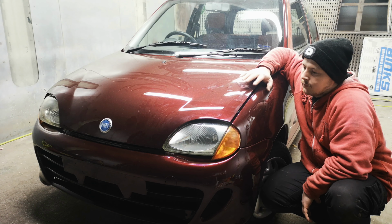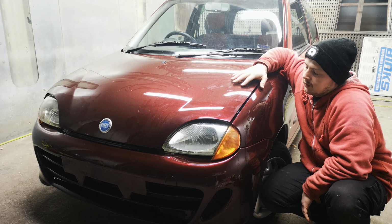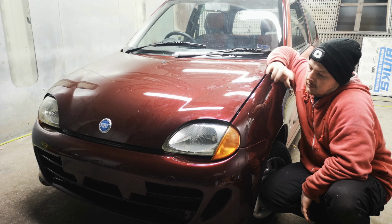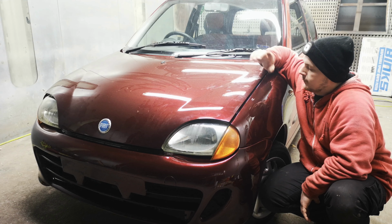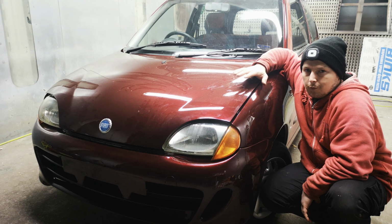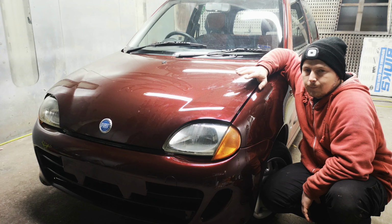Then the car was sprayed all around. Obviously it was in parts, in bits, so everything was in stages. First the bonnet went in, the bumpers, front bumper, back bumper, sides. I sprayed that up, the same 4 coats of base coat. That was curing and I left it.